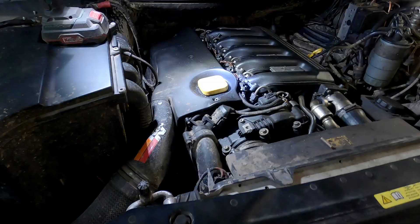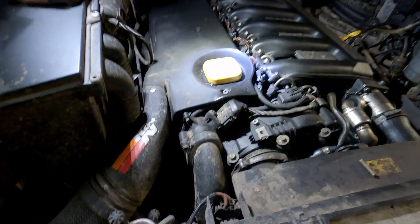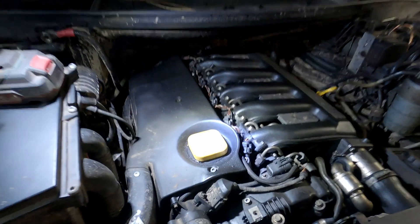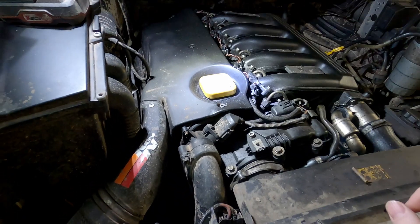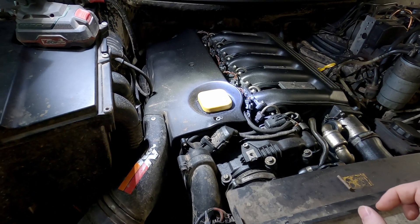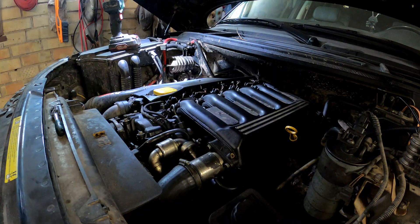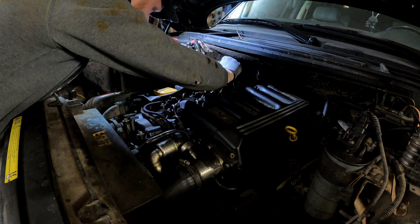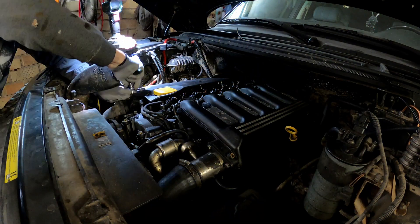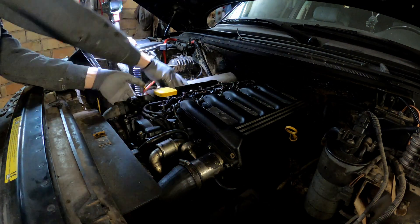It's turbo time! Hello everyone. Today, and maybe tomorrow, I will be trying to replace my turbo for this Range Rover L322 with BMW M57 diesel engine. My turbo is in really bad condition - the engine is constantly losing power, stuck in failsafe. I want to take out the turbo and look at it because it's making strange noises and not always working. The engine has power maybe 50/50 - sometimes it has it, sometimes it doesn't.